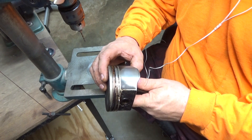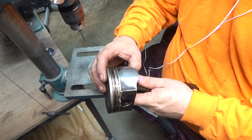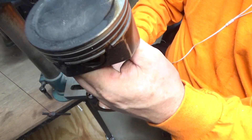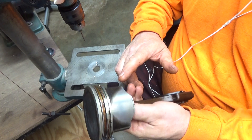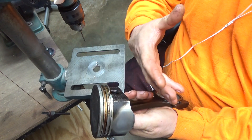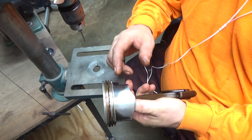People do this. I've only seen a couple videos on it, but I've talked to a right many machine shops and they do this all the time. Now when a piston moves up, the compression's going up. Whatever leaks by there gets trapped by here — it hits the oil ring some. But on the downward stroke, it's still got compression, and some of the compression gets by here on the downward stroke. The windage from the motor gets by here and pushes the rings out on the cylinder bore as it goes down. With these little holes I'm getting ready to drill in it, it helps that expand it — not only from the sides, but all the way around.